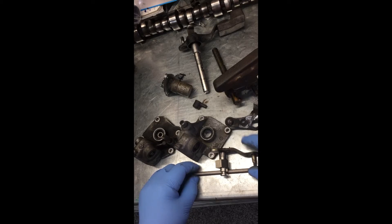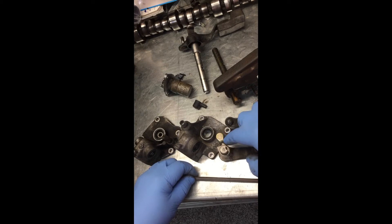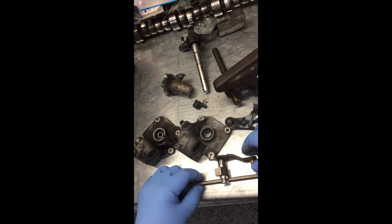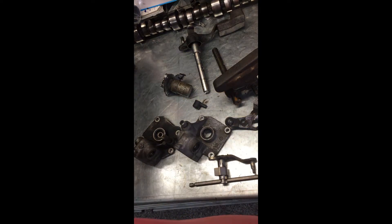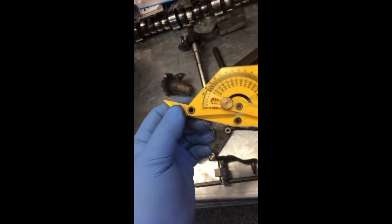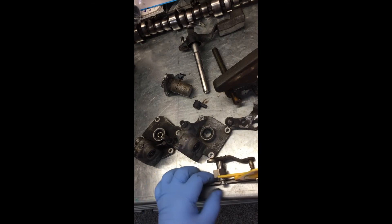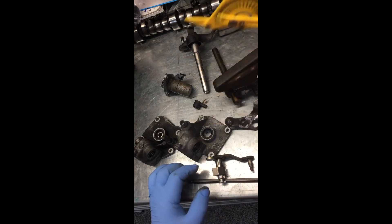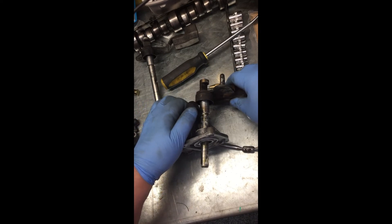You can see the little groove here in the shifter pin for the shift selector. There's a lockout mechanism that has to slide into that groove on the pin, and that's what the five-speed one does not have. I'm pointing out the relationship for all three — you have to make sure you're correct on the angle and that the pin is square in the lever, so I used a little angle finder to set this guide in.